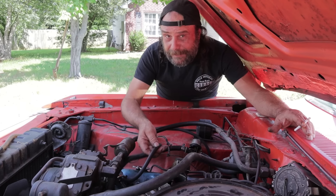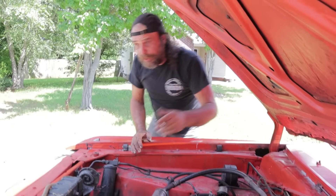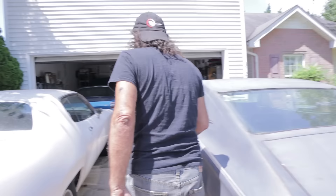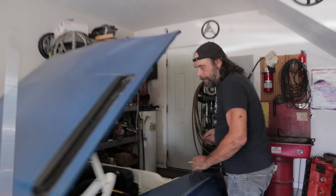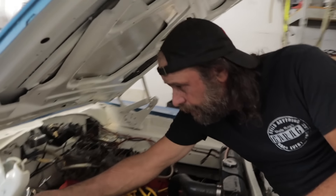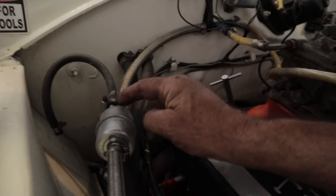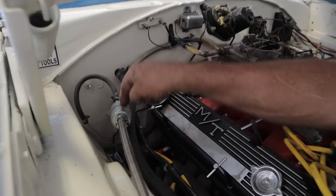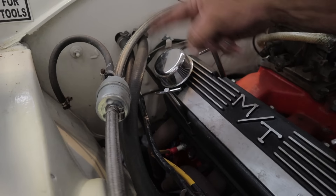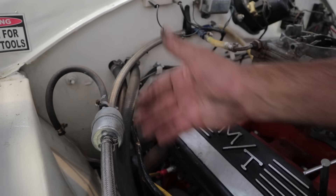This will take care of about 90% of your fuel percolation and vapor lock problems. On our '68 Road Runner, we have the same basic setup. This is a Wix filter, but this one actually has the orifice built into the filter itself. Here's the main line coming from the fuel pump — it comes around and tees off to the carburetors. Right here we ran a quarter-inch line all the way back to the tank, where it's teed off so that the pressure is able to vent itself back into the tank without upsetting the incoming fuel flow.